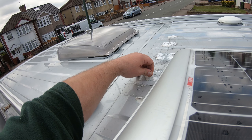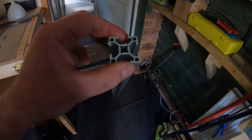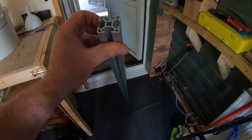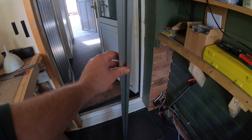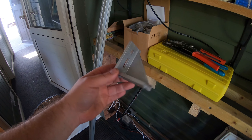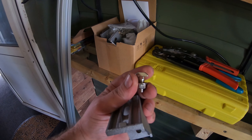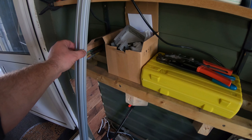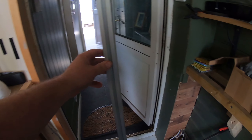These are the roof bars - 30 millimeter by 30 millimeter aluminium T-section bars, 1.5 meters, which is a standard size you can buy. I'm going to cut these down to size to make up a framework for the solar panels to fit on. I've got aluminium right-angle brackets to attach it to the Fiamma system that's already up there. These come with T-bolts, and I've got right-angle aluminium brackets to connect the solar panels to these bars.